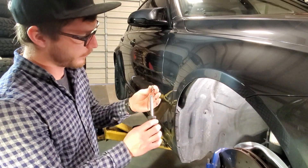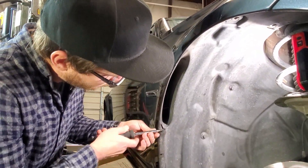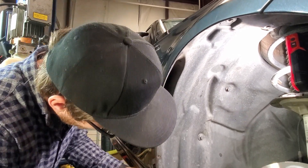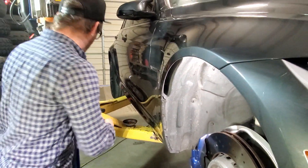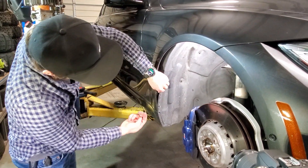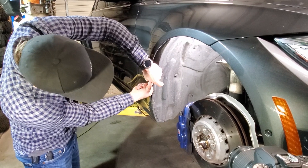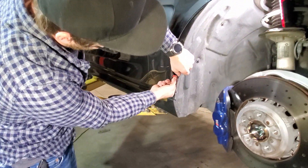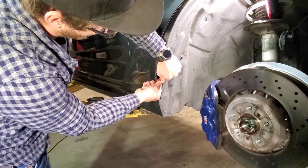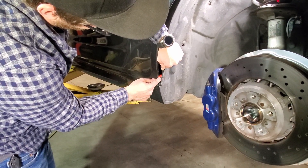With those cores punched out, we'll go ahead and throw a flat head bit into our screwdriver and pop these out. Now to gain access to the mounting holes, we'll lift this out of the way, then take our red clips and make the extruded side so that it's on the back side and just align those with the holes here. Put it over the liner and just kind of slide it down over the hole and put it in place.